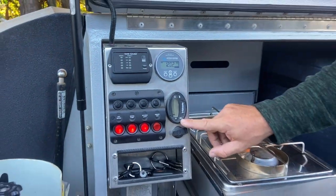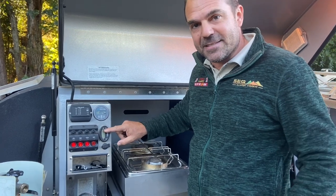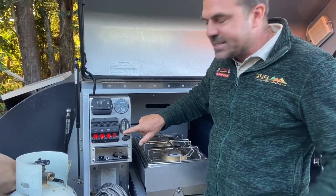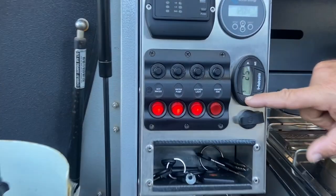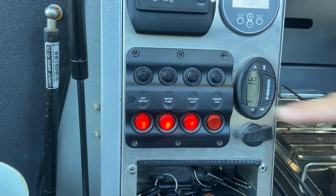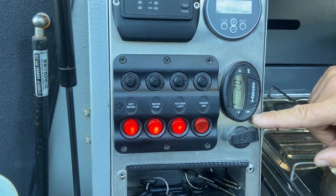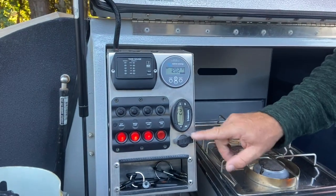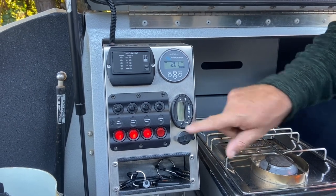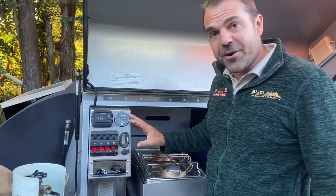If you need to get it running again, you may have to start it up to 10 times just to get the fuel back in the system. The flame icon appears but the 30-minute timer disappears — press the up or down arrows to see or adjust the time. If time runs out, add more minutes or press the flame button again. To turn it off, don't use the main switch; just press the flame button and it will shut down.